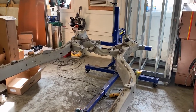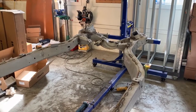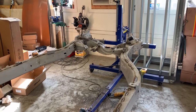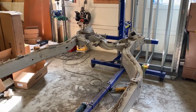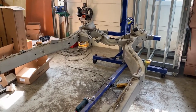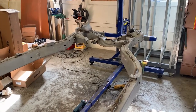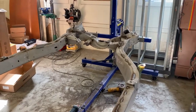Back in the shop today working on the Corvette. Huskers aren't playing Wisconsin today so got plenty of time for the shop. Got all the front suspension off, the suspension and power steering unit removed. Measured for the gussets around the lower A-arm supports and cut out the steel.